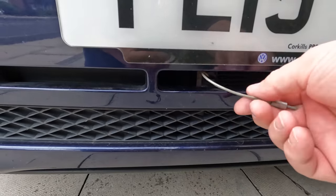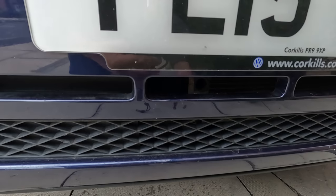Two things have to happen for the unit in the car to operate the vacuum and apply the brakes. You can check the unit is working by pulling out the breakaway plug. I pulled the breakaway plug out and the unit operated — I could hear it, so I knew the unit itself was all right. So I thought I'd better investigate further.